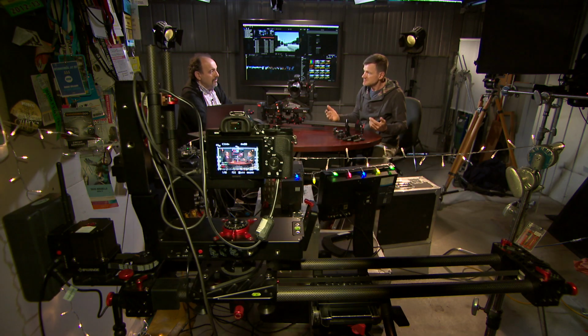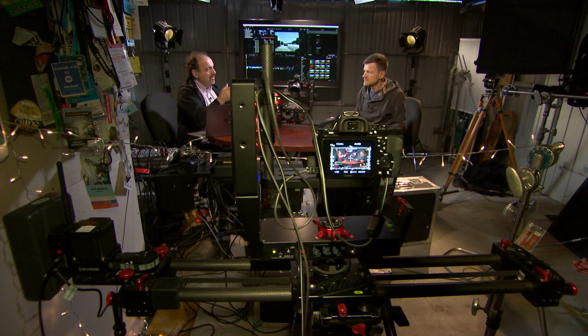I love it. You just have it going on its own, continually back and forth in ABA mode? ABA mode. So I have 3 presets. Think about the typical one-on-one interview where I'm using this as the side shot: I can have one preset if the person's sitting camera left, another preset if the person's camera right, and another preset if I just want the thing moving but keeping the center of the frame centered all along. So for me, that's how it works. It's simple.